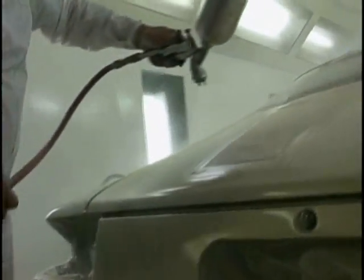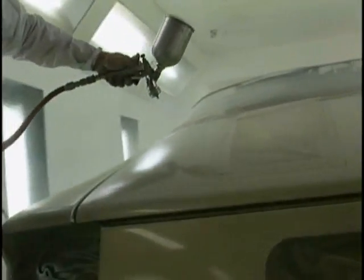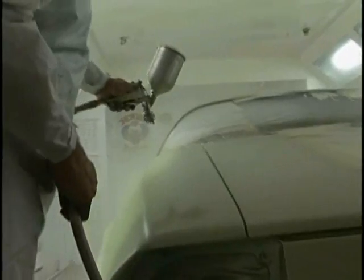Don't let the converging panels trick you. Make sure you get in and turn the corners. Put the sealer where you need it. Don't miss any spots, because they will haunt you if you do. When you start putting on that metallic, they almost don't cover at all. If they don't have a base under them, you're really in trouble.